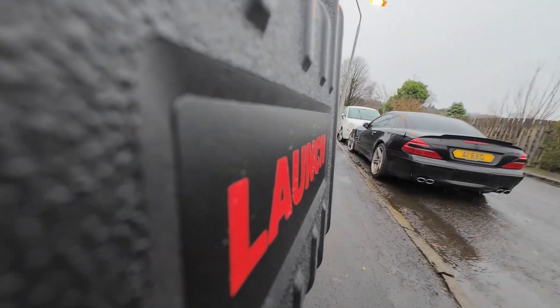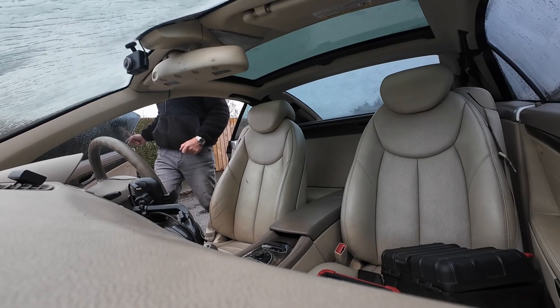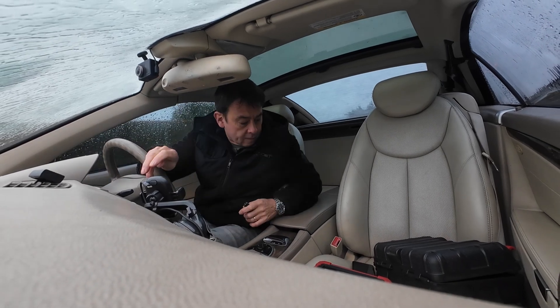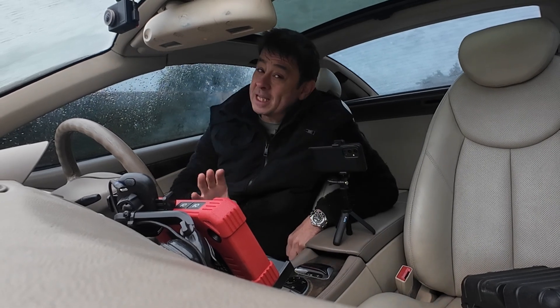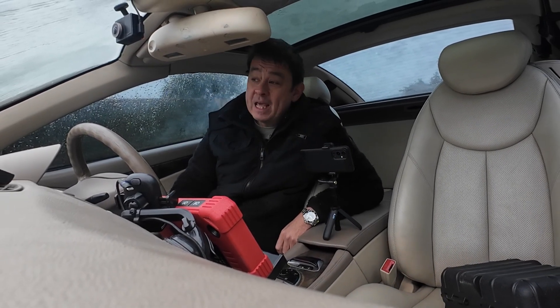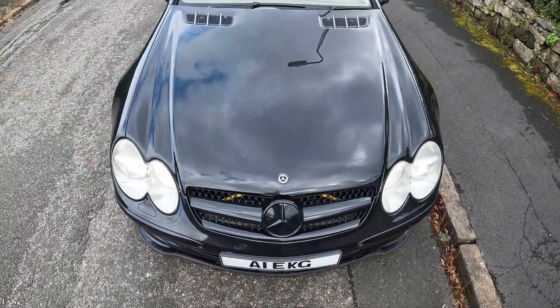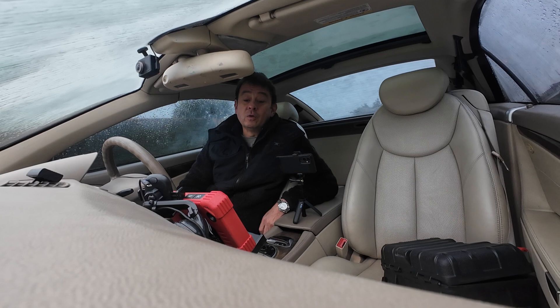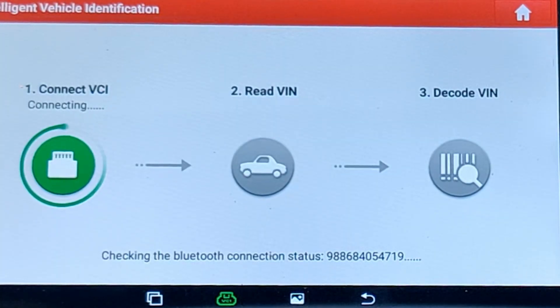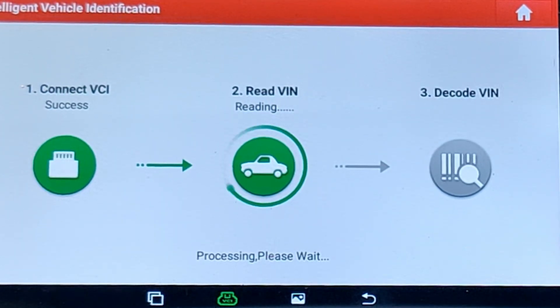How far am I and how clear do I sound? This problem with an aging sensor has been coming up on many of my videos - I just haven't got around to doing it. It's an oxygen sensor and I think it's just had its day. After all, the car's over 20 years old, so it's probably got burnt out, sitting on the exhaust. Let's go into diagnose and have a little look. Let's go to intelligent diagnostic. It's going to connect with the Bluetooth module and do a handshake with a serial number activation, which is all done previously.